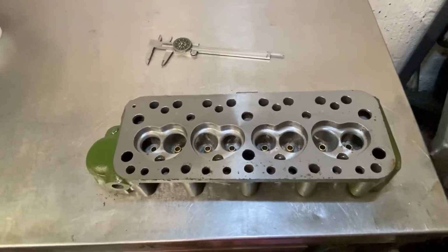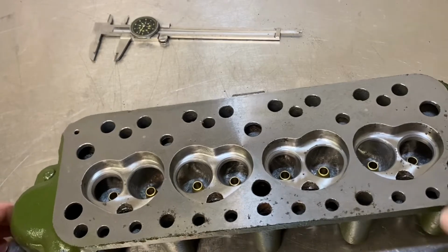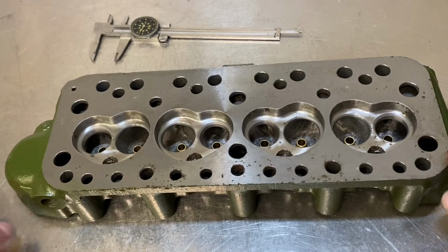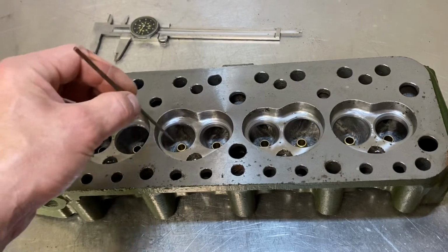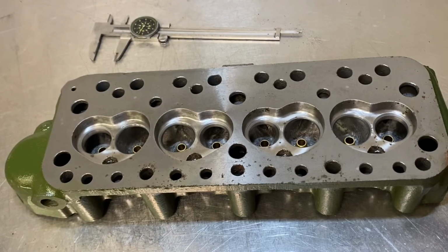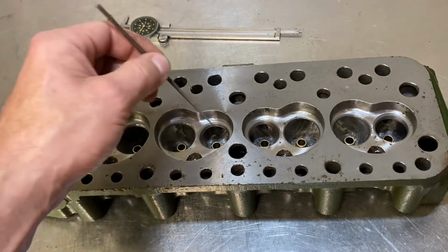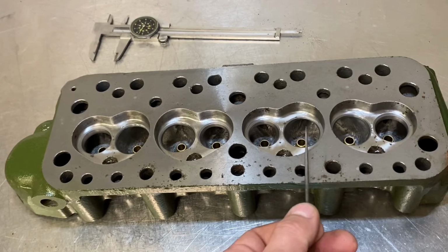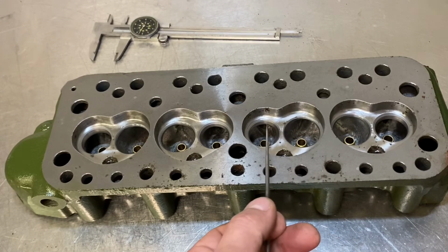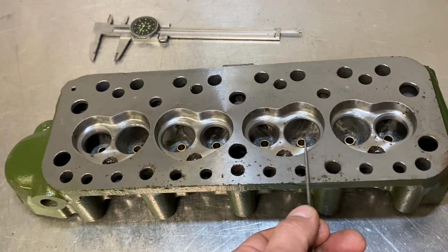So this is a much more open chamber head compared to most small bore engines. You can see that the beak, although this is a modified head, has basically remained the same sort of shape. So it's a much more open chamber head, similar to a 1275 head, but with the valve spacing that fits in a 998 bore diameter. So you can see there's quite a big gap between the two exhaust valves. This one's actually modified for a 29mm exhaust and a 33mm inlet. Normally this would run, I think, a 25 standard exhaust, and a 29 or 30mm inlet.